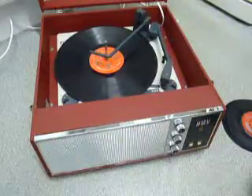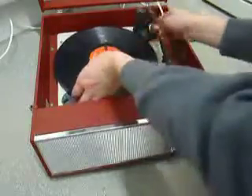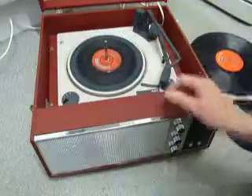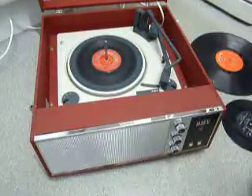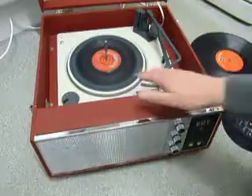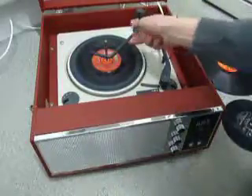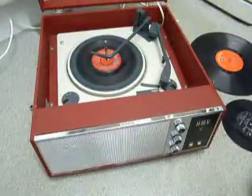If you don't want to use the auto changer and you just want to play one record manually at a time, you can just pop an individual record down the spindle onto the mat and select the first option on the right-hand dial, which is manual. That starts the turntable turning and you can then place your arm onto the record yourself. Once the arm is on the record and it's playing, carefully load the stacker arm down like so, so that it knows to switch off automatically at the end of the record.